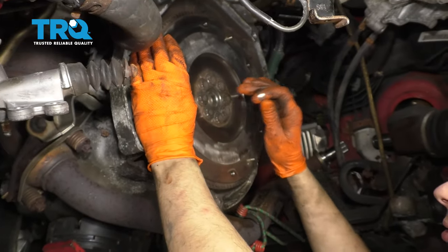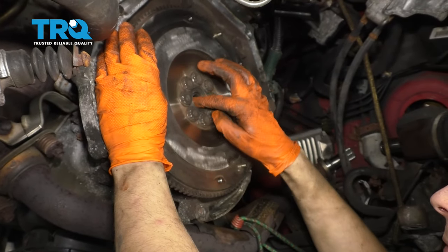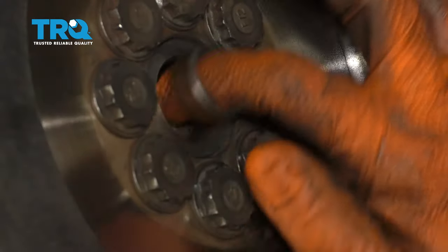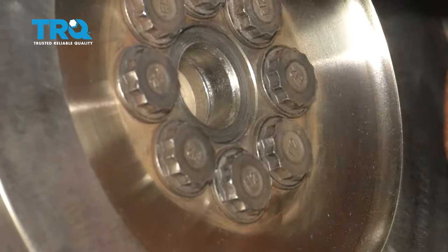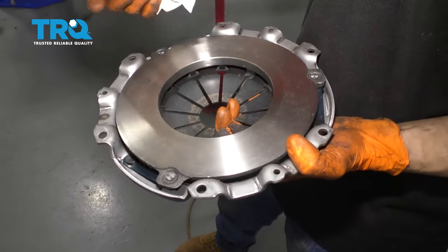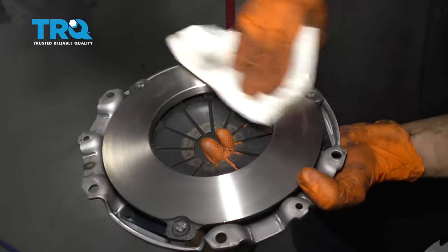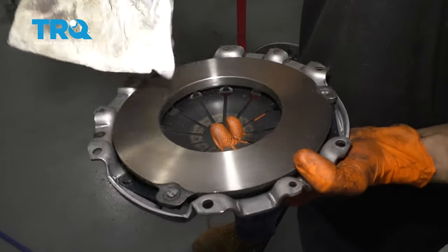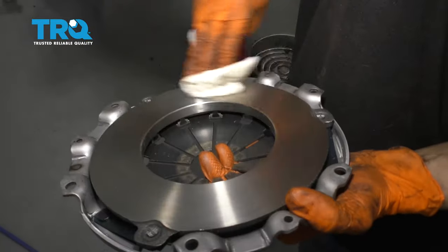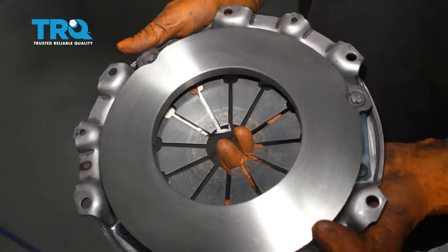This car does not have a pilot bearing — some don't. The kit came with one that kind of fits loosely, and that's not good — usually they're a press fit. So if yours did not have one, do not reinstall one. If yours did have one, you can remove the old one and press the new one in. Here's the new pressure plate. I have some brake parts cleaner on this rag and I'm just going to wipe it down in case there are any oils from shipping. You want this to be nice and clean, free of any oils or debris. Preferably use a rag that does not leave behind much lint — if there are any oils on this, your clutch isn't going to work great and it's going to wear really fast.